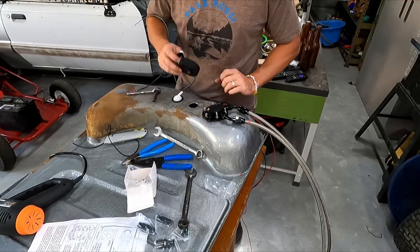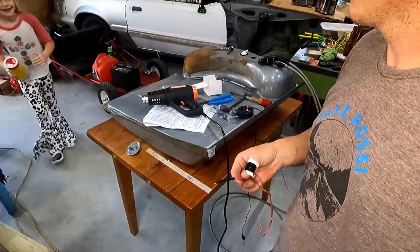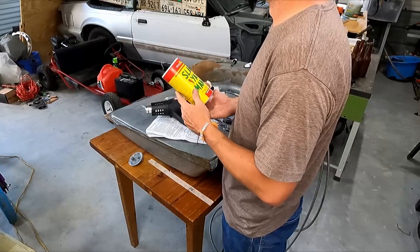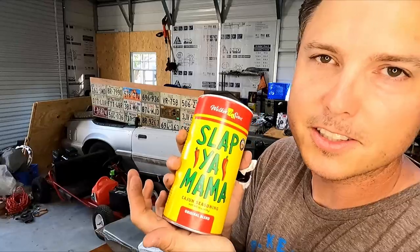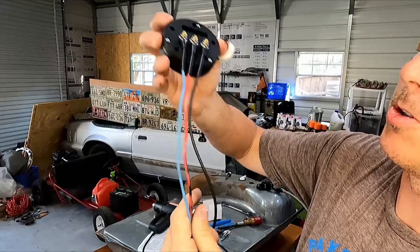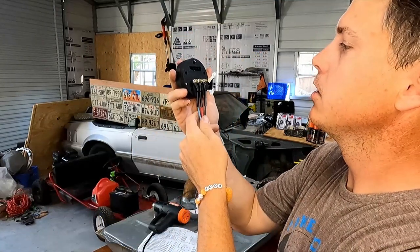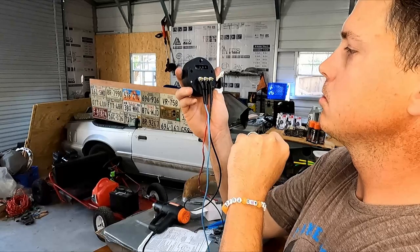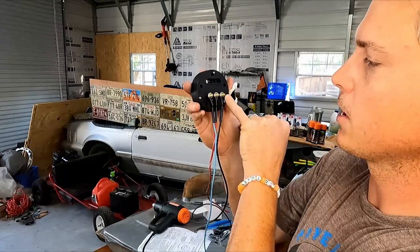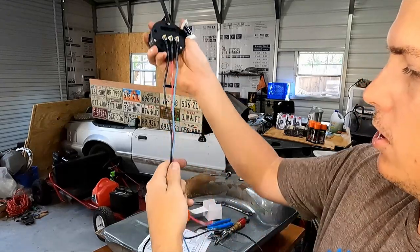I wanted to use the rollover valve, so the Easy Fuel Sender goes here — it takes a power supply that's keyed. Got the Easy Fuel Sender all wired up in red, white, blue, and black — patriotic. I did it backwards — I'm going to switch this around. I want this to be the ground and this the gauge. We got a nice ground, a nice 12-volt supply, and a nice gauge signal wire — they're just pigtails. I'll have to make connections later, but I do want some sort of disconnect so if I have to drop the tank in the future, I could disconnect the pump and drop the tank.